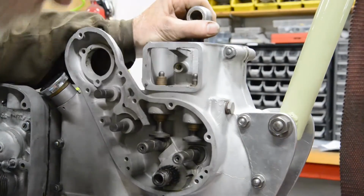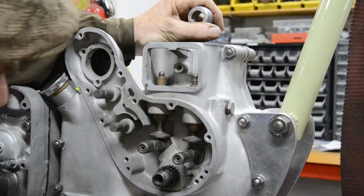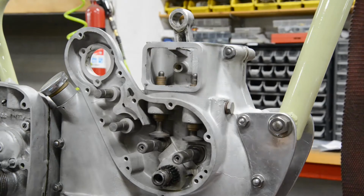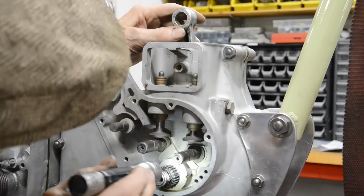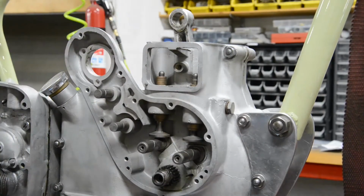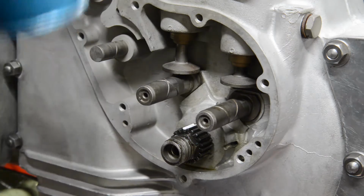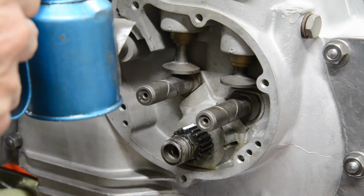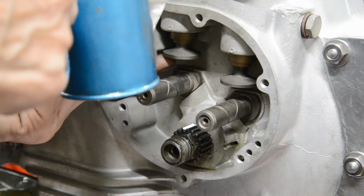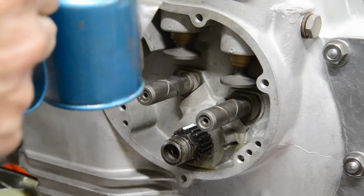So now then, we've got a top dead centre. Why do they keep doing this? It's the same as the BSA ones. And I didn't think on. You screw that on and it covers the dots. Let me take it off and mark the dots and screw it back on. Well, I put some white marks on so I know where they are. So let's put some oil in various places here. We'll oil these again later on, but this will all help.